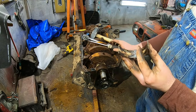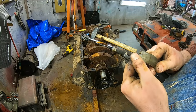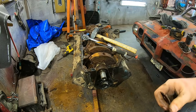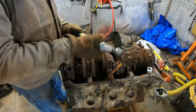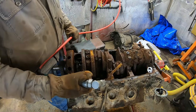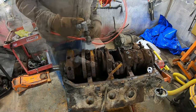Well, see, you know how they say you don't want to see copper? We really don't want to see this. GM 400, that is. These are factory bearings, it's never been into. Before we go too much further here, I'm just going to take the whiz wheel here and clean up all these bolt heads, try to get to the rod caps that I can to perhaps facilitate removal.